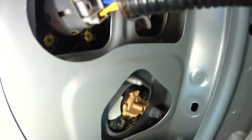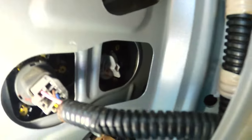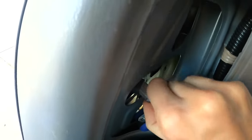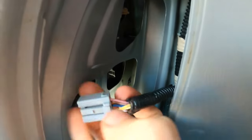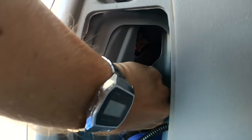To take these out, all we have to do is turn them counterclockwise just a little bit. I'll unplug this reverse light — push in this little tab right on the end and you can pull that out — so I have more room to get to that turn signal. It's a tight squeeze but it just unsnapped.